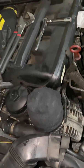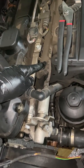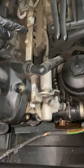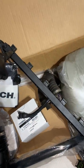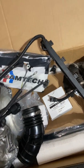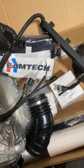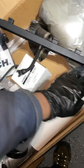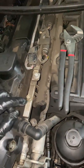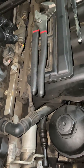I'm probably going to have to take this off, because eventually I'm going to have to get to all the plugs on this part of the wiring harness. This is the fuel rail right here — you can see one of the injectors. This has six, just like the new one has six plugs for each injector. I'm relatively close to being done. I have these three plugs plus the two grounds: this plug, that plug, that plug, that plug, and the six injector plugs, and it should be good to go after that.